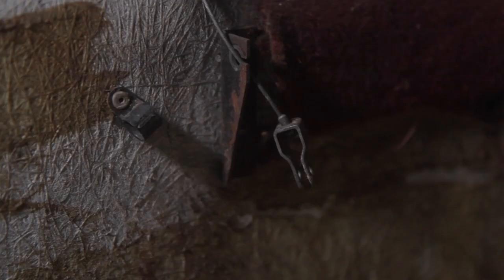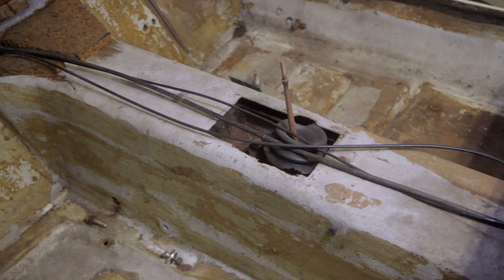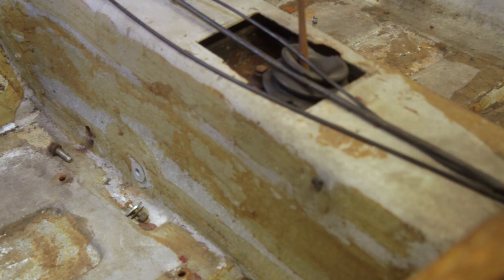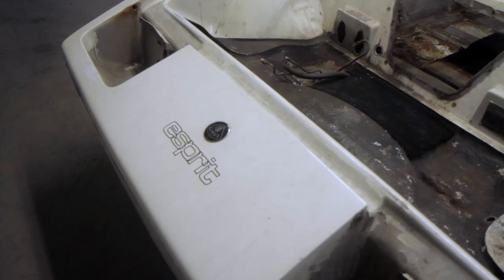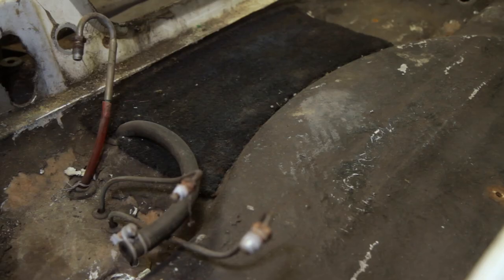We'll just try to get the body to clear that bolt when we get that far. In the cabin, the throttle cable, some of the heater controls, and the speedo drive are still running through, so we've got to pull those back out. They literally run through the rear bulkhead and into the engine bay — nothing complex about this at all. I initially thought I'd need to drill out some rivets on a bracket, but I realized I didn't need to, and our snaky cables slithered back through.